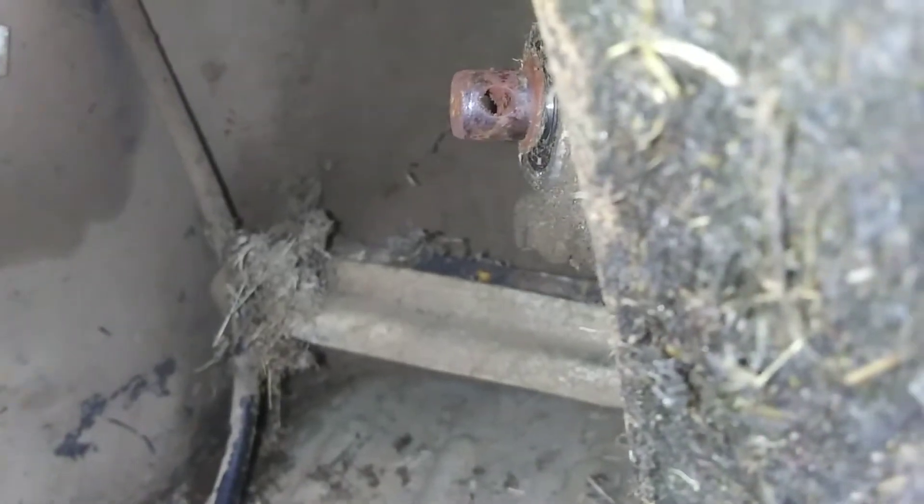I'm going to take you to that. This is the inside of the bottom of the mower, and this is the transmission — right there, that sticks out. You see that hole? That's where the CV joint attaches on the transmission end. And if you notice, when you raise and lower the wheels, the transmission goes up and down. So keep that in mind.